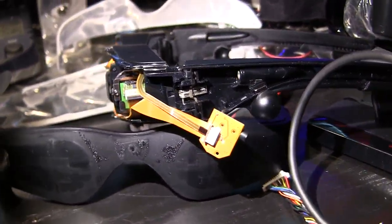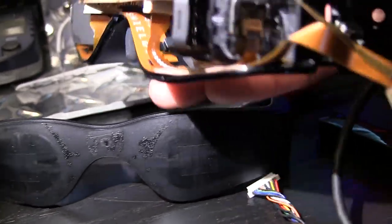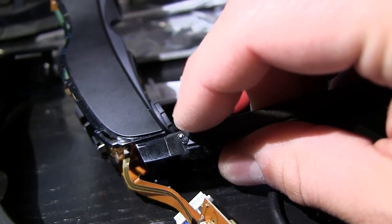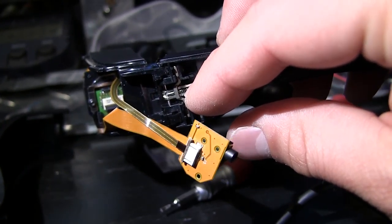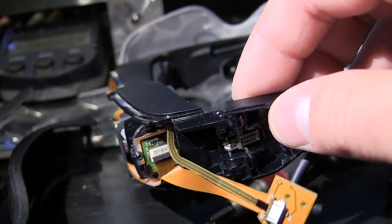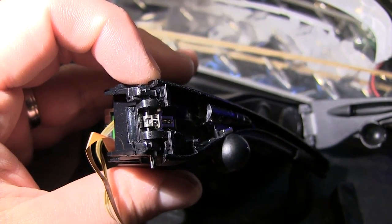Here's where we are in the deconstruction of the Cinemizer goggles. If you slowly work the side around you'll be able to pull the front plate portion off, which will expose all the inside guts of the Cinemizer. That'll let you access a little hinge pin that's holding the arm. I also loosened up the spring tensioner on the corner so the pin can slide out. I pushed the pin out just a little bit and I'm going to use some needle nose pliers to pull it the rest of the way and separate the arm.